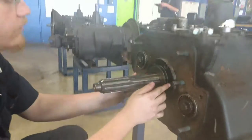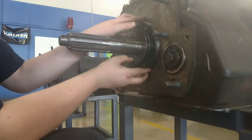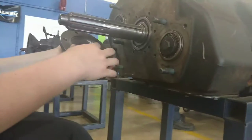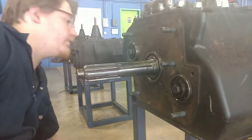To start, you're going to remove these six bolts here on the retention plate. I've already done it for this video, so we slide this plate off. Make note of where the oil hole is in the oil return line. Set that off to the side.